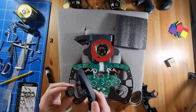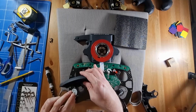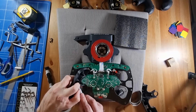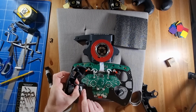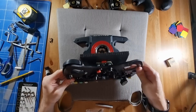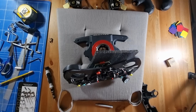The first thing I did was route the cable for the haptic motor through the channels provided in the new grips, using the pry tool to push them in so they're held in place. Once I was happy with their placement, I flipped the grip around and slowly got it to sit in. I had to wiggle the motor in to fit it into the original seating position — that's the easiest way to get the rear of the grip back on. I tried doing it on the other side without putting in the motor first and realized my folly pretty early on — it's very difficult to get it in place.